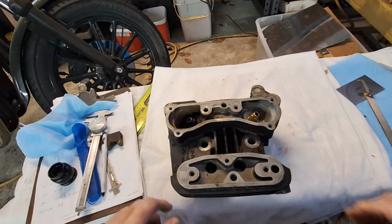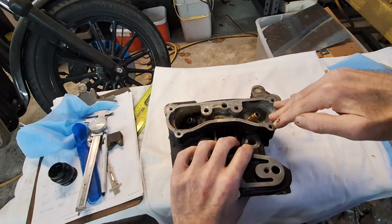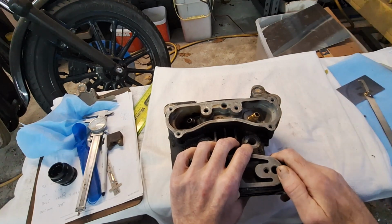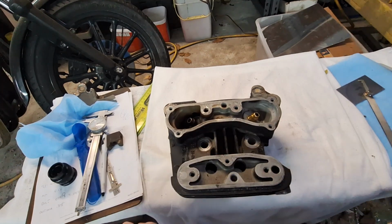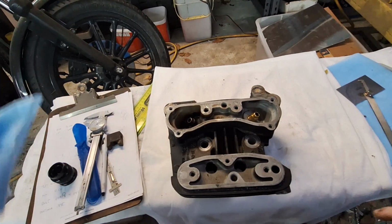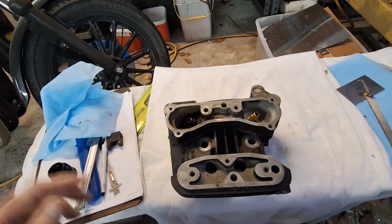And what happens when you get a valve angle like that, with more straight shot ports, you find that you don't need to run as big an intake valve or exhaust valve, because you can get the head to flow better with smaller valves. So better port velocity, more grunt out of something with smaller valves, and it still flows enough to support the engine at whatever RPM it's running to.